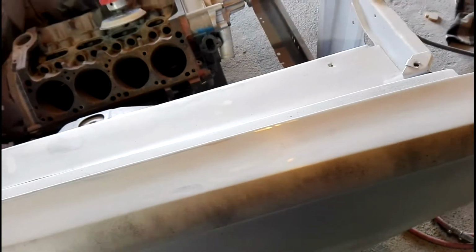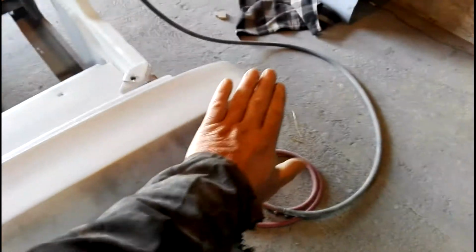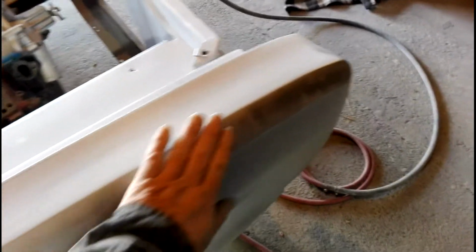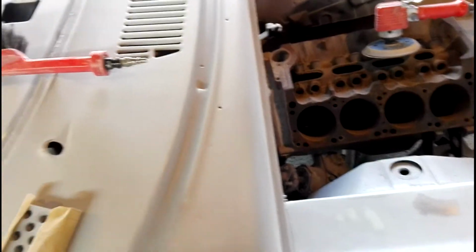Because as I'm coming along and sanding it off, it's straightening that edge up. In the steel there could be just a gentle little wave, but with the thickness of the material or the paint, you're straightening that out. So if you roll over, you're not straightening that out. Do you know what I mean? So it's probably just a little tip for you. It's the same with all these sorts of edges. Try not to roll over them too much.